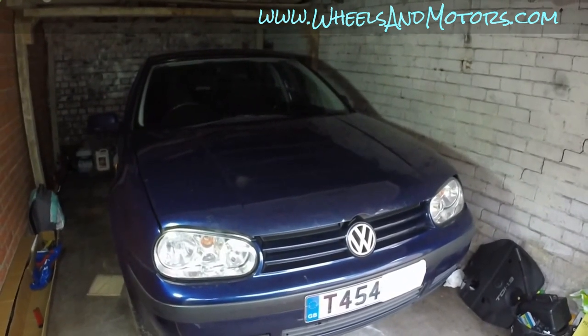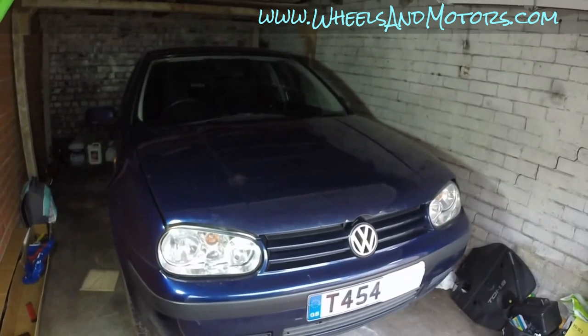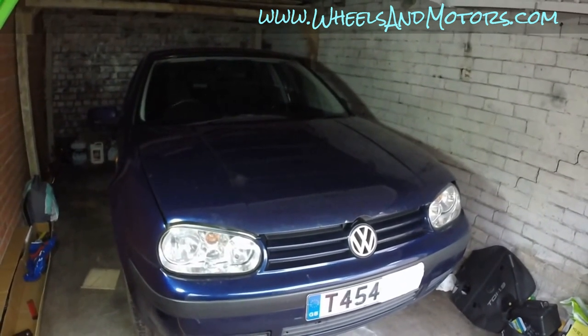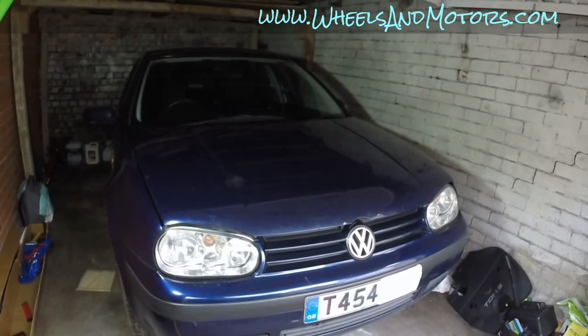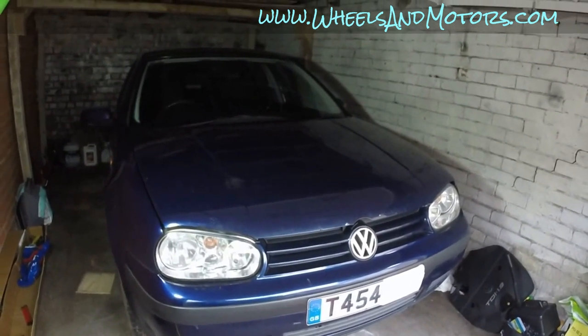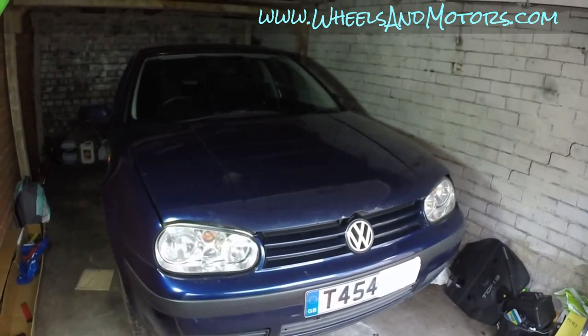Volkswagen Golf Mark IV 1.9 TDI engine. This video will show you how to replace the auxiliary belt, also known as the alternator belt or serpentine belt. This car also has a horrible tensioner for that belt, so I'm going to replace the tensioner as well. So it will show you how to replace the belt, and if you need to replace the tensioner, it will show you how to do that as well.